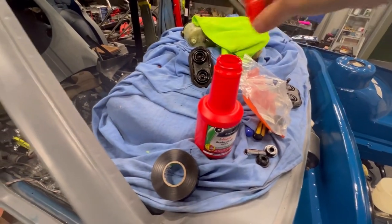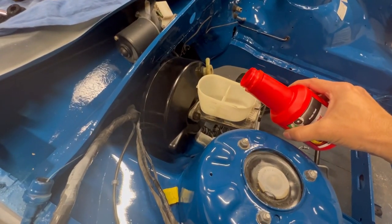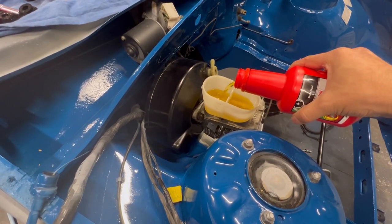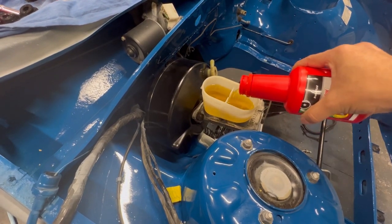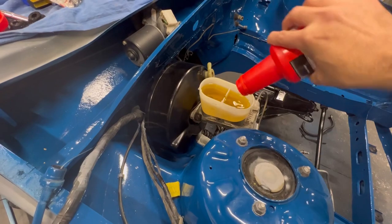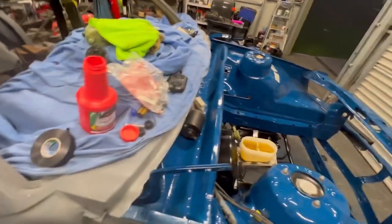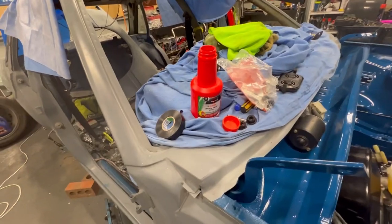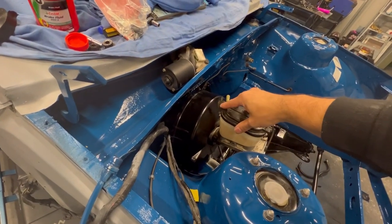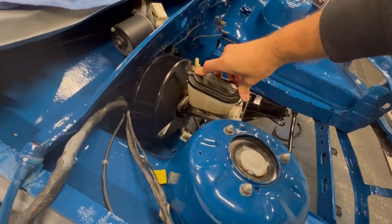The only issue I'm going to have — have I got enough fluid now to fill it back up? Let's see. Oh look at that, golden nectar! Oh, it's very clean that is. Pretty much all I have and it's just a tick under full, so next time I go to the parts store I'll get the same bottle — Castrol brake fluid Dot 4. We'll get our new lid and pop it on. Clip — oh it's a lot tighter — clip done.